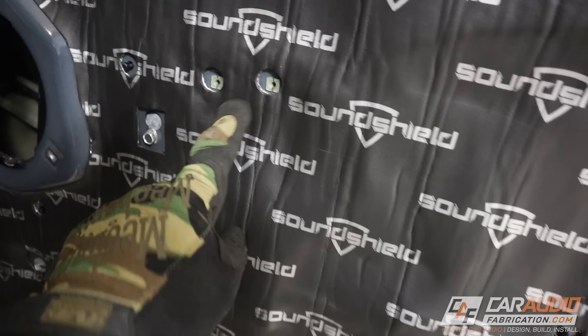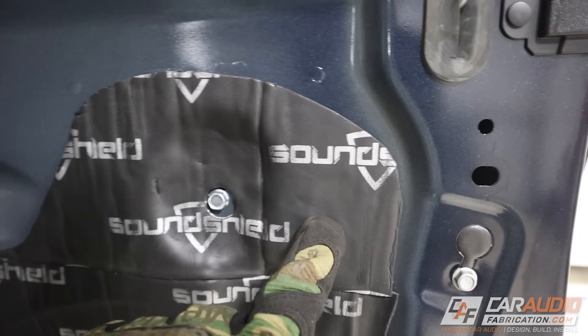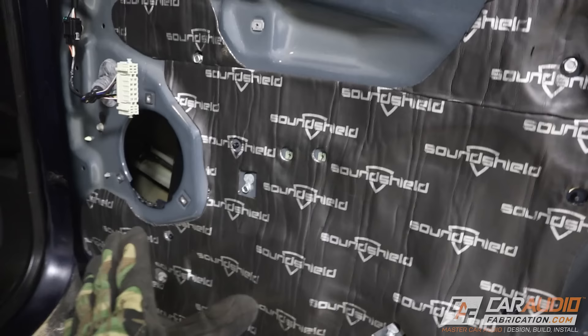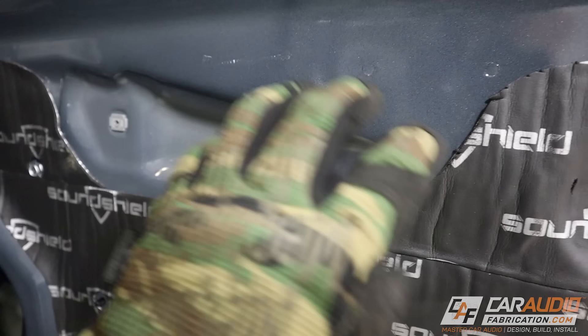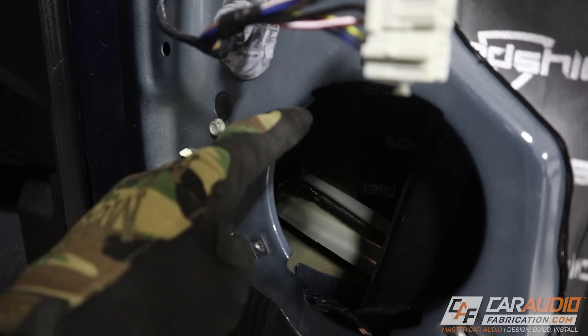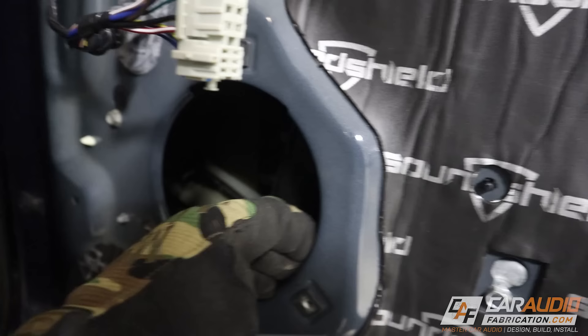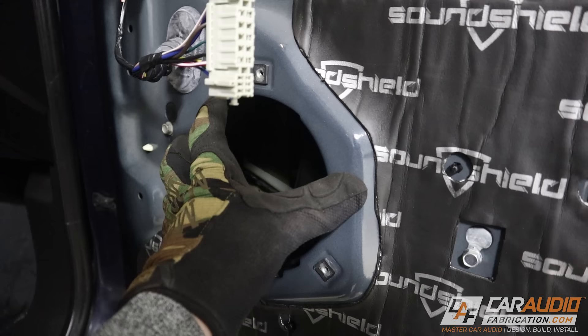Here's a finished look after I applied all of this. You can see we have nice clearance for the mounting holes that hold the door panel on, we've got cutouts for these bolts so we know where they're at, and I also added a piece here and here to my original cutout — there were just some holes in the door panel, and I wanted to cover those up. That way it makes the back side of this door panel like one big speaker enclosure. I avoided this area here because it has a lot of bends to it, so it's already strong. And this is where the door pull assembly is, so I don't want to interfere with any of the movement of that. GM actually did a pretty good job here — they have this roll on the edge of the sheet metal, which adds a lot of strength to that part of the panel.